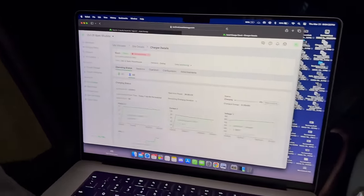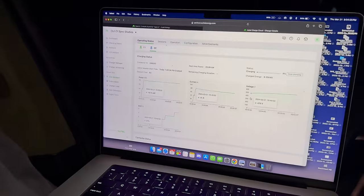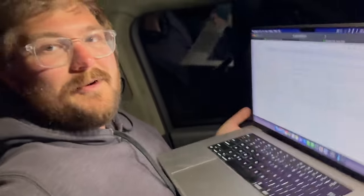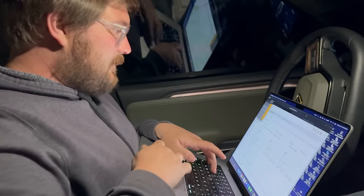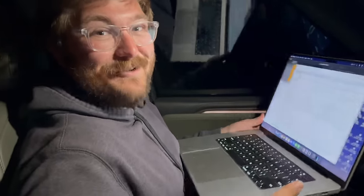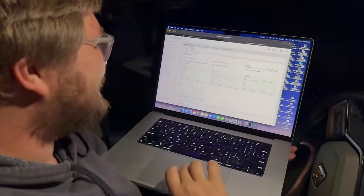And it just refreshed on us. We're now at, what SOC are we at? 4%. And you can see dead voltage was 477 volts right there. And keep in mind, that is with the pack doubled. So let's just get the exact number, 477 divided by 2. While you were driving, you were at 238 volts. That was the operating voltage. Wow. Well, yeah, right at the bottom. And maybe even lower when you were moving and sagging the pack. So no wonder it didn't want to move that 8,200 pound thing. Yeah, exactly. You were just dead.